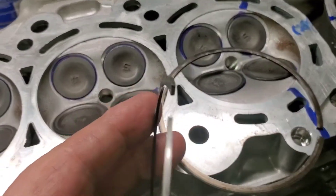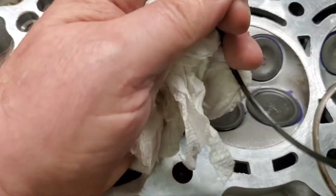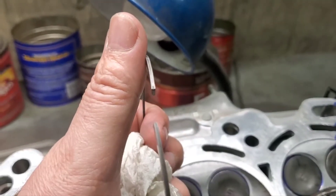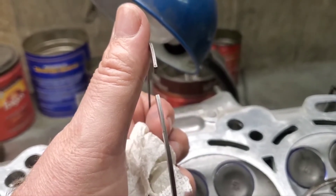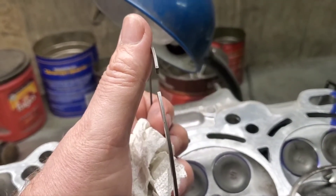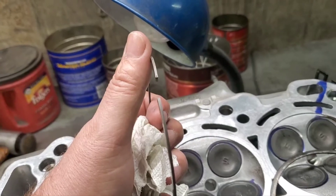The Moly ring — you can see here on the end of the Moly. The top ring, which was the Moly ring, you can see the Moly is being blown out of the center of the groove that the plasma was installed in. This was installed in the second position, and the dots on both these rings were turned down. I can't even imagine what somebody's thinking building an expensive engine like this and not putting the piston rings on correctly. We're all human beings, we're all subject to making a mistake, but this is a big-time boo-boo.